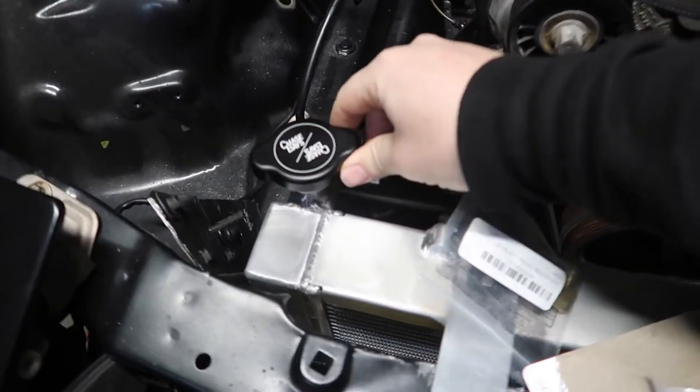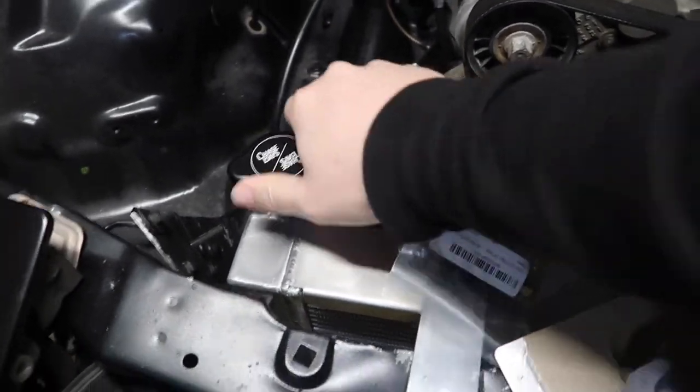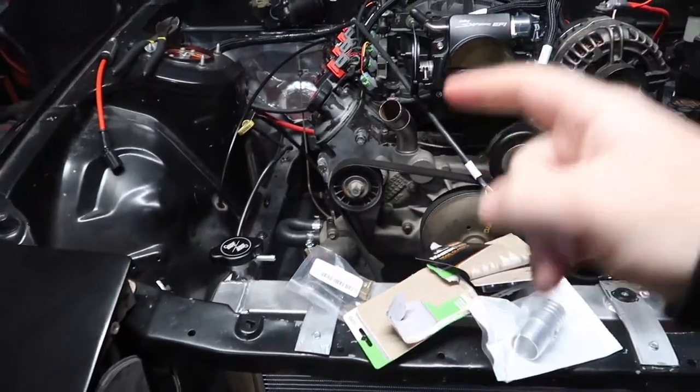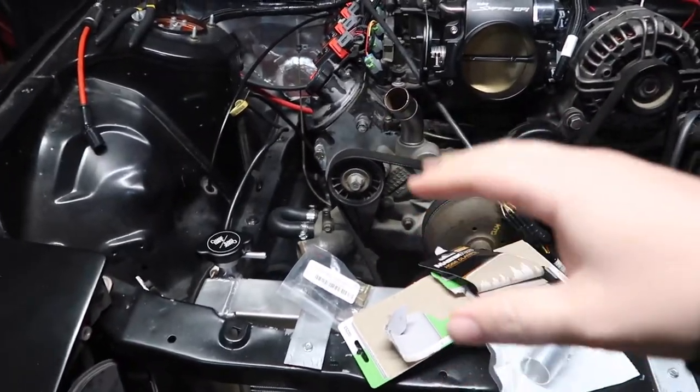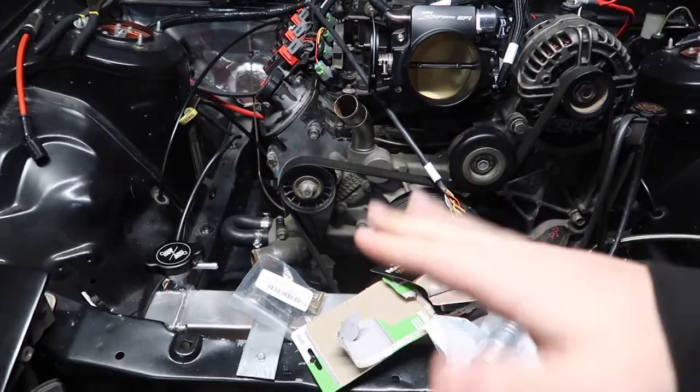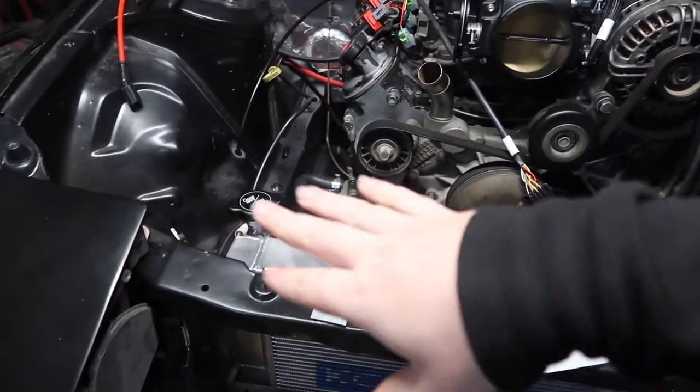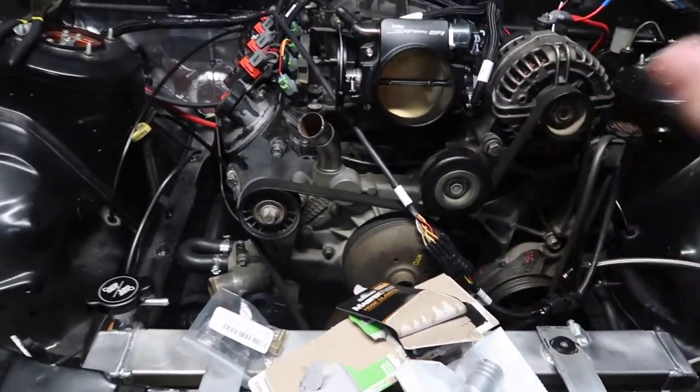It's got this new Chase Bays radiator cap because I needed one, and it's a high pressure cap, which means that I should have roughly the same boiling point running just water as I would with a normal radiator cap running 50% coolant. I'm gonna add clean out the car to this list for this week also.